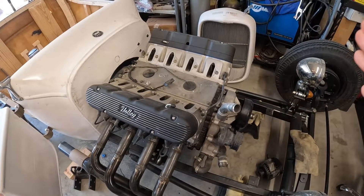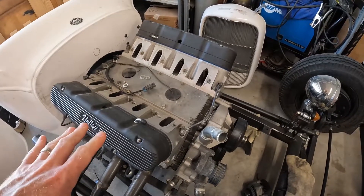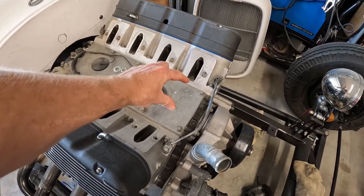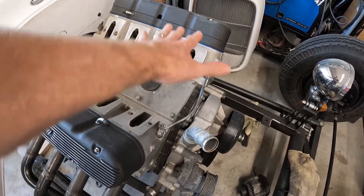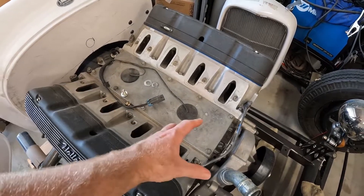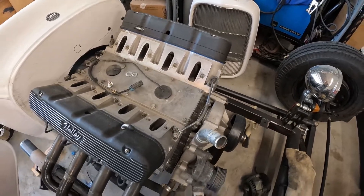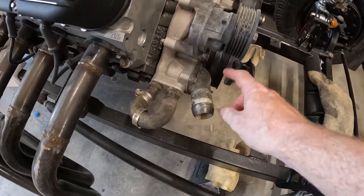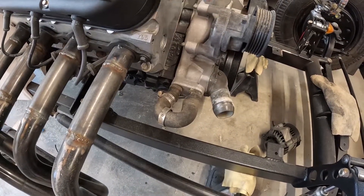It's a pretty simple explanation. Think about if this was a small block Chevy — the thermostat housing would be up here, that'd be the highest point within the engine. So any sort of air or steam that gets trapped in a small block is able to flow out of the engine through the cooling system. But on an LS, the thermostat's way down here, below the highest point of the engine.